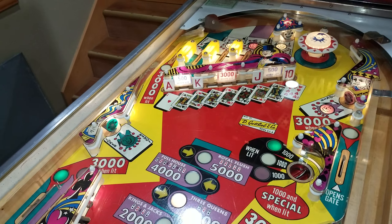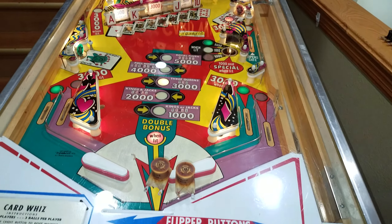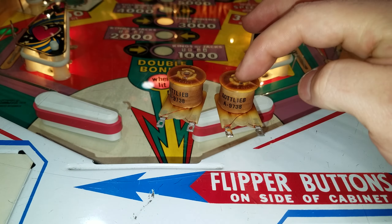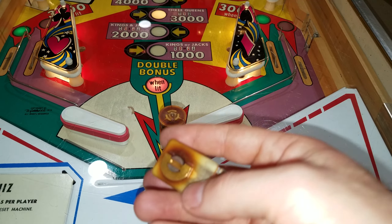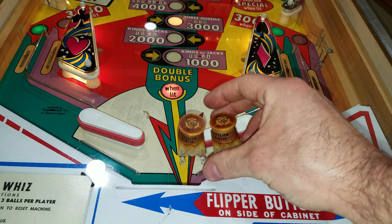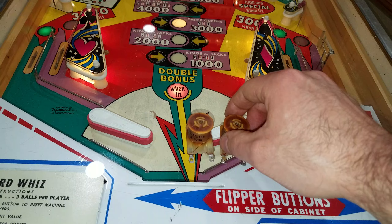One of the things we mentioned from last time on that bottom panel were some of the hold relays that were getting kind of toasty. Looking at the actual schematics, this was the tilt and then the tilt hold relay. You can tell they were getting toasty — from when they were installed you could see this halo burn mark, and this plastic bobbin started off as that tannish white color.